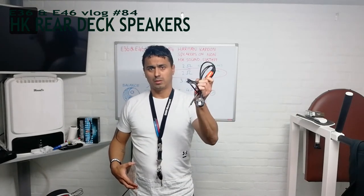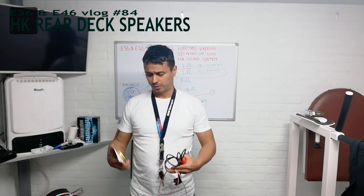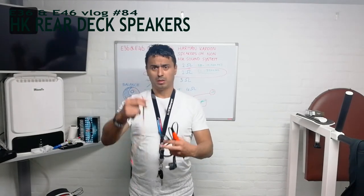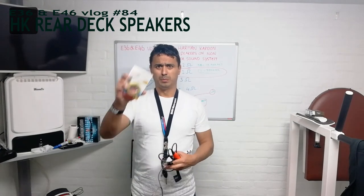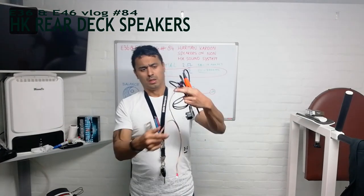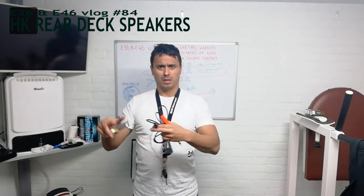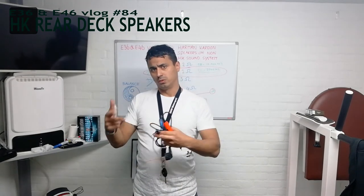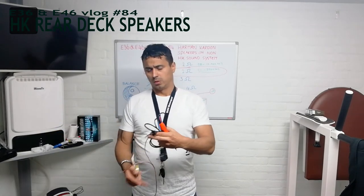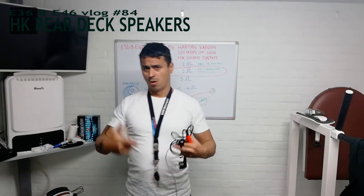I had to get back to the garage because the other soldering gun didn't get warm enough and the soldering didn't get liquid. Another tip: when you put these wires together, make sure you put good isolation between them, because when those two wires hit each other it will blow up the fuse from your amplifier, or when you don't use one, from your head unit. Make sure to isolate it well with isolation tape or some rubber.